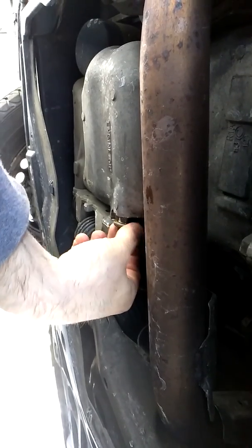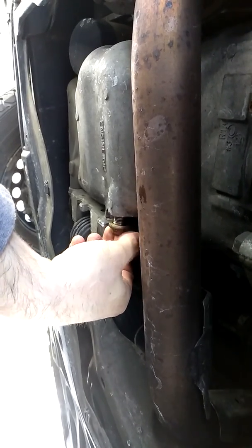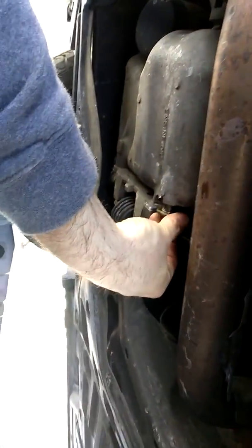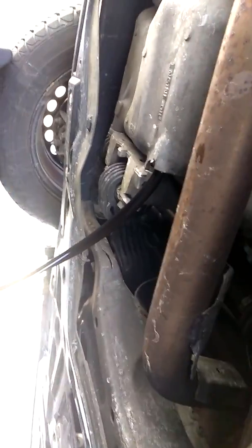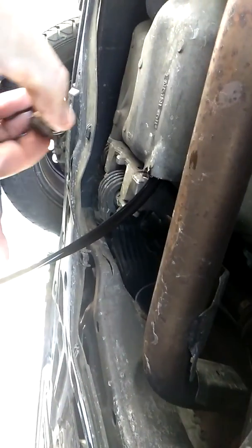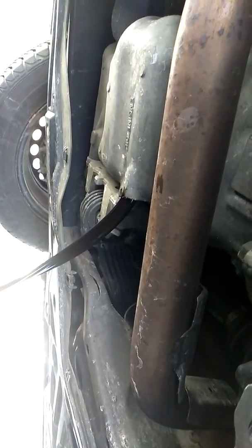What you're going to do is loosen that up. Let it drip a little bit — I'm kind of missing the pan a little bit so I've got to pull this forward. I would normally lift this pan up to it until it slows down a little bit. So I'm just going to let it go and it's pouring right into that now. As it starts to slow down, you might have to drag this pan a little closer because that stream is going to start to drop straight down rather than going out. Right now there's about 4 to 5 quarts of oil in there — I think this actually only holds 4 quarts of oil. They say 3.9 but I just put 4 to make sure.